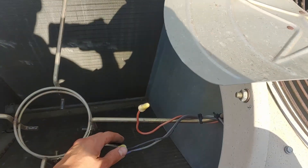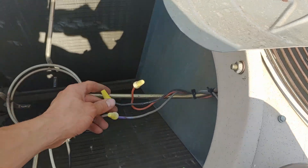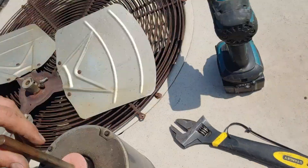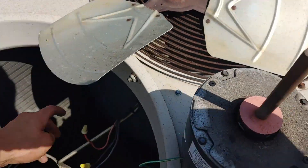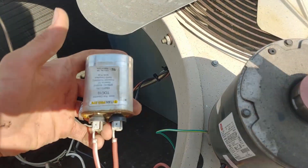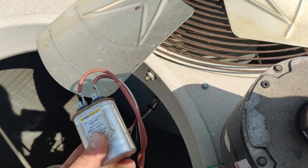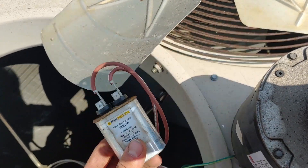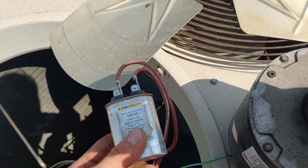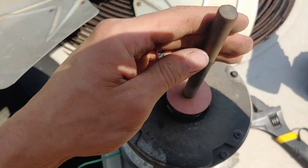We got the motor pulled up. It's being fed by this black and this purple wire, and our new motor is the same as the old one, so we'll just wire it back up the same. It also had a 10 microfarad capacitor — we checked it and it was at 9.55 microfarads, so we know it wasn't the capacitor. When I tried to give the motor a spin it wouldn't take off, so we know a bearing in this motor has failed.